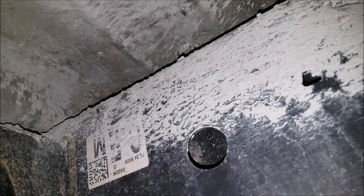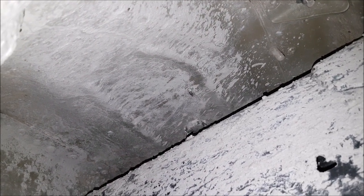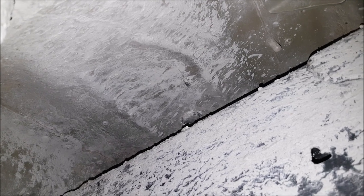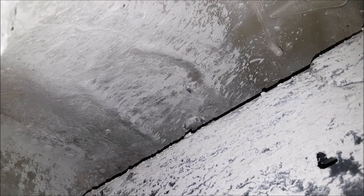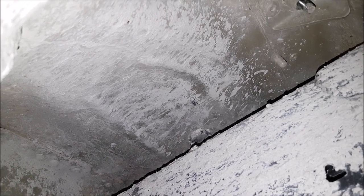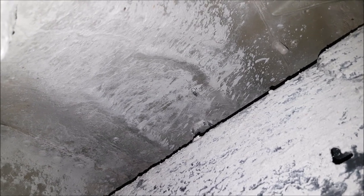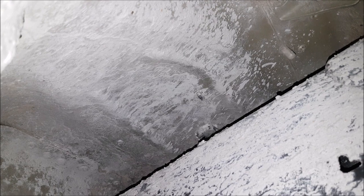Looking underneath this truck, it gets used, so we don't want any corrosion issues over time. You could punch a hole through the floorboard, put a bunch of dielectric grease, put the nut on the other side, and spray it with undercoating or silicone, or just keep hitting it with fluid film every year. There are a variety of ways to prevent corrosion. But there is a TSB on these trucks from Ford, and they really recommend that you don't punch holes into the aluminum sheet metal.